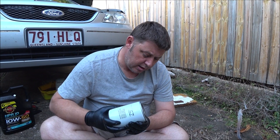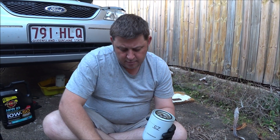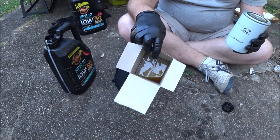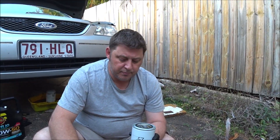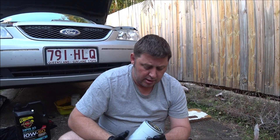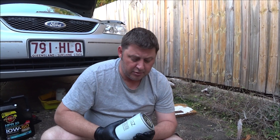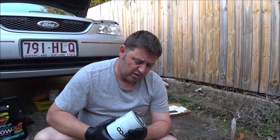So if we rotate this on its side for a bit, now when I start the car, instead of getting that much oil out of the first 600ml, I should get maybe 50% of the oil through in the first couple of seconds — which is more than what you'd get if you don't do this at all. You'll never fully soak this unless you leave it overnight on a little rotisserie, but it's better to do what you can that's easy than to not do it at all.